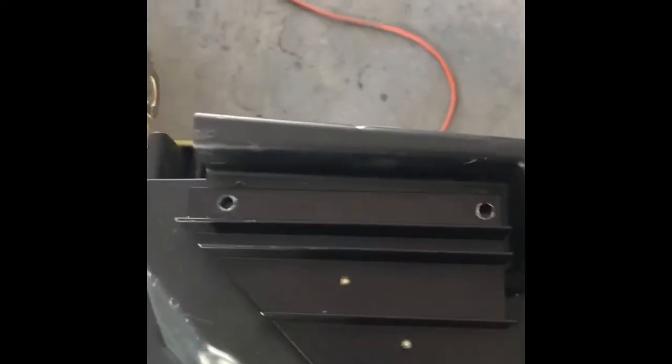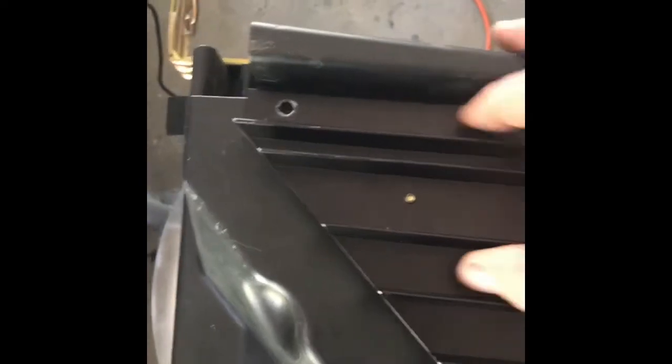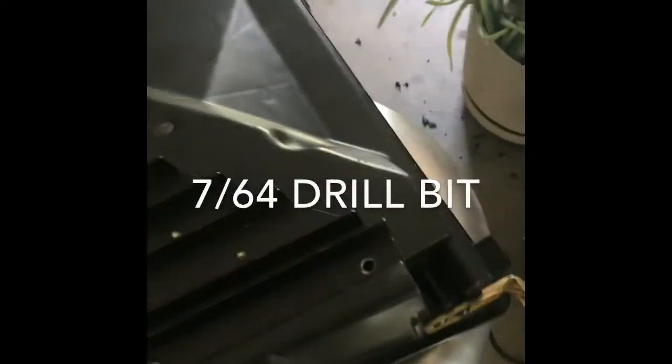With the screws out, there's a little gasket so you have to break that seal. I'm sliding the amp over to the edge of the box — we have about a quarter inch of slack — seating it against that edge, and sliding the bottom flush with the edge. The original screw holes no longer line up, and we've exposed part of the opening. Since subwoofer boxes should be sealed for good bass, when we finish we'll fill that exposed hole with silicone. Next we need to drill pilot holes using a 7/64 bit.